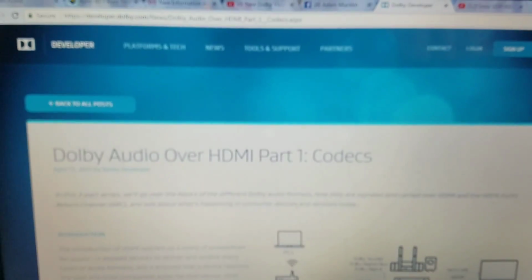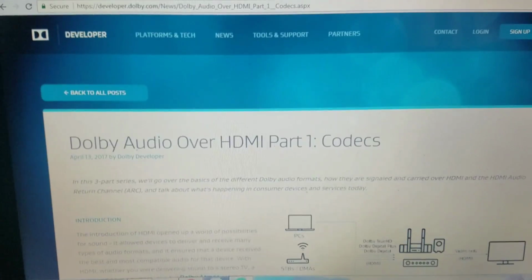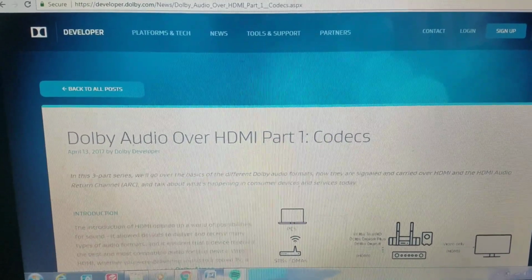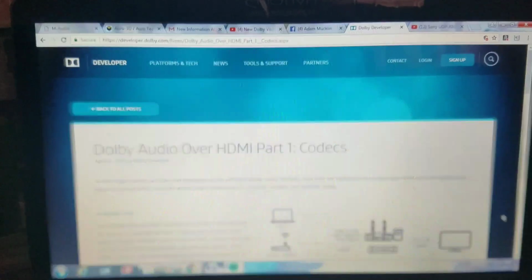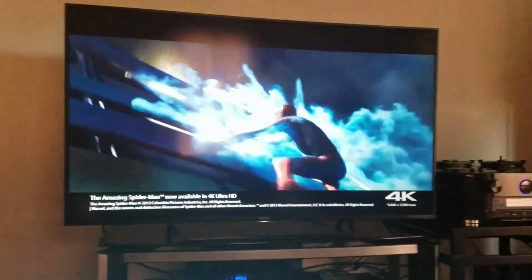If you don't take my word for it, or don't understand this video, or don't believe me, so to speak, well, you've got this literature to look back on and basically confirm what I'm telling you. So it's a 3-part series, and we're going over the basics of the different Dolby audio formats and how they're signaled and carried over HDMI and the HDMI audio return channel. And I'm talking about what's happening in consumer devices and services today, so you can see right here. So I'll just get into my little video here, as I've got some background visuals and some audio for you.